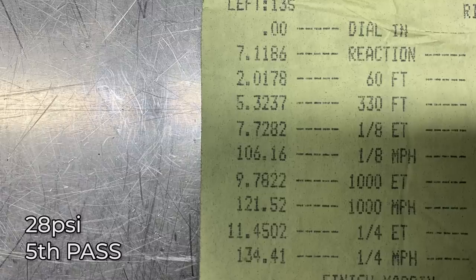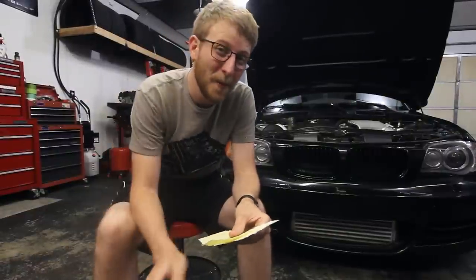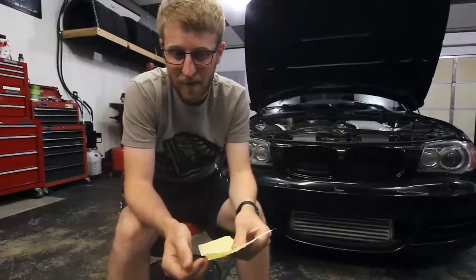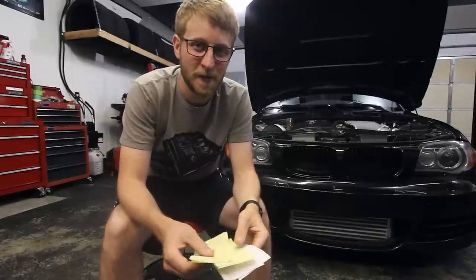Now without the two-step, again, I'm reverting back to my old thought of trying to use that 7,000 RPM rev limiter. So I rev this puppy up to 7,000 RPMs and manually slip the clutch myself this time instead of bogging it. And she scooted out the hole pretty good, so good that she burned the tires off. It started spinning really bad, and at that point, I just shifted it into second, and again, it kind of bogged because I was burning through the tires too much.